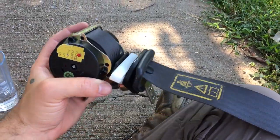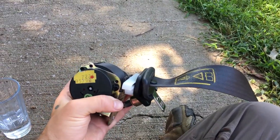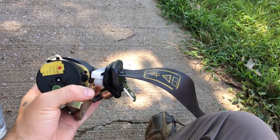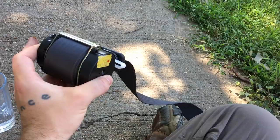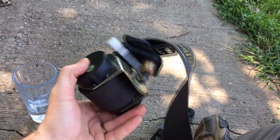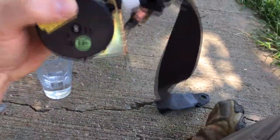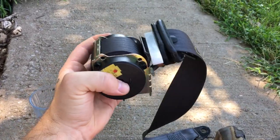I'm going to show you how to fix a locked seat belt mechanism on a Land Rover Discovery 2. Mine is a 2004 and this particular one is the passenger third row seat belt. This one came locked — it was locked in place. I got it used, sent with a jump seat kit, and it would not retract. I bolted it in so that the inertia mechanism — there's an inertia mechanism in these things — if it's tilted the wrong way it won't release.